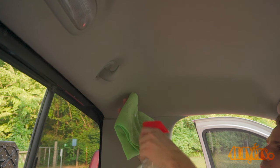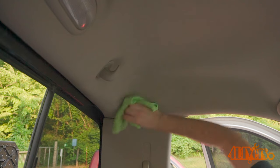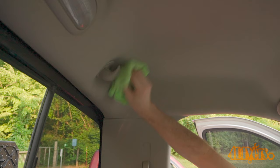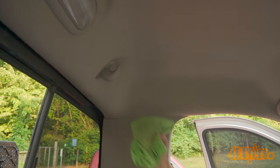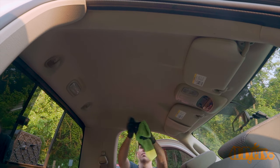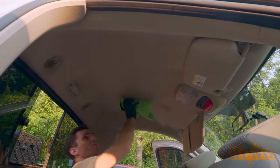For the larger area, the whole area was quite dirty. For larger areas such as this, a microfiber cloth is the best solution. Apply the cleaning solution to the cloth — the cloth shouldn't be overly saturated, just damp, and the cloth isn't pre-soaked in any water. Applying it to the cloth instead of the headliner will help reduce any mist in the interior. Then wipe down the headliner working in multiple directions. I'm using a brush as a backer behind the cloth — a larger brush makes it more efficient and easier, and only light pressure is needed. Work in multiple directions to push the fibers around, ensuring any dirt is removed.